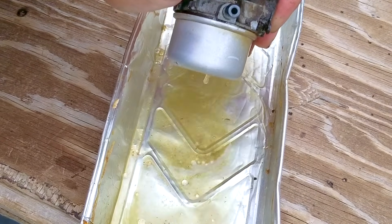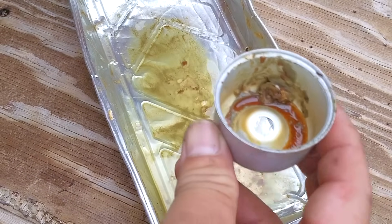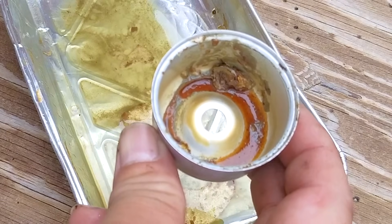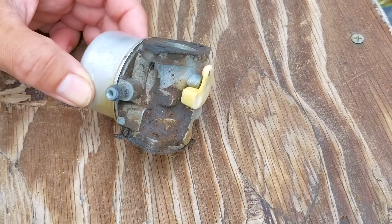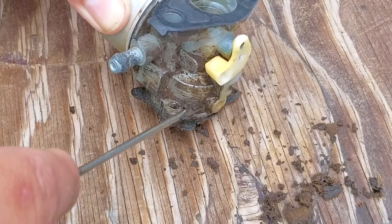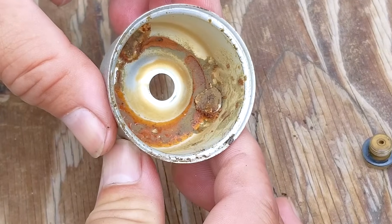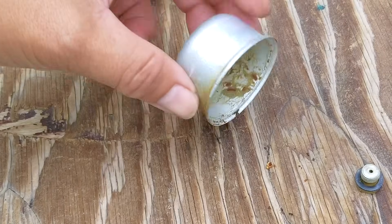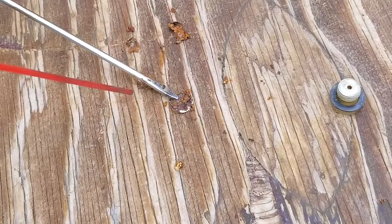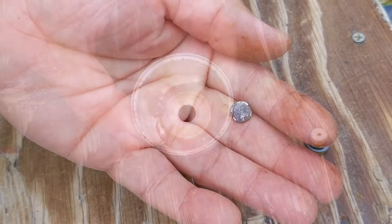It's a good thing that we did, because what came out of the carb doesn't look good at all, and it explains why the engine stopped. As you can see, there seems to be not only sediments in the gasoline, but also water. And once you take a look in the bowl, you can see why it looks as bad as it does. I'm surprised that with the way it looks in here, the engine even started and ran at all. I do have plans on putting this carb into the ultrasonic cleaner, but unfortunately I need to clean as much of this dirt off the body of the carb first, otherwise I risk getting some inside the carb as well. After cleaning the exterior, we can now get a better look — what we see here is terrible. This is rust, which only makes sense because what came out of the carb also had water in it, and this water is what caused the engine to stop in its tracks. It looks like one of the Welsh plugs came loose and was sitting in the rust, so we'll have to clean that off and try to reinstall it as well.